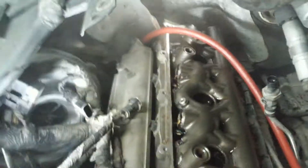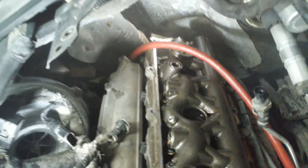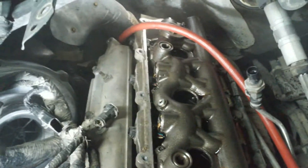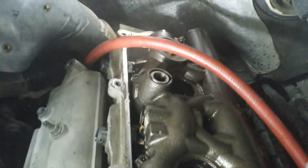They had said that if they crack open the side, they want to do all the injectors. So we're going to call them and double-check that, and make sure we need nipple cup O-rings on this whole oil rail. And if we do all the injectors, we'll go ahead and get those put in. Then we'll have to retest and make sure the passenger side is actually sealed up. But definitely got a leak right there — number eight.